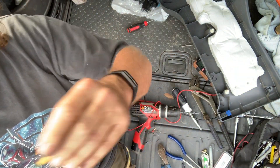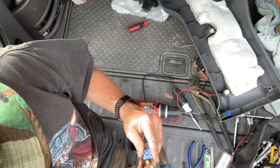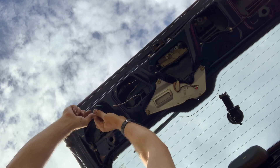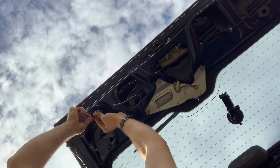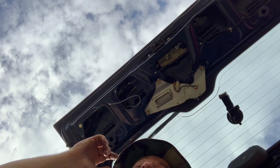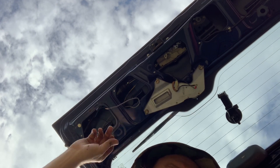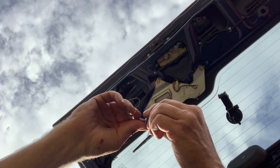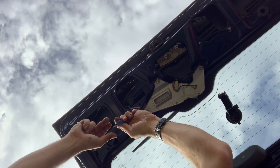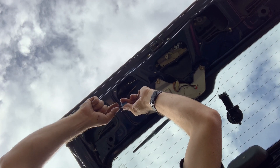I've had people ask how I do that and I'm like, I don't know. We're going to go with wire nuts for now but this connection definitely needs to be soldered. This is the ground wire — it's going to go to the blue wire on this particular actuator. If you're buying this same cheeseball one off eBay, blue is the way to go. This green wire is going to hook to one side of the plug, and our hot wire that we ran from the light inside the car hooks right here on our switch. We're wiring the switch to the hot wire, then the other side of the switch to the actuator.